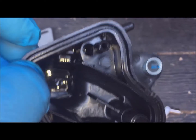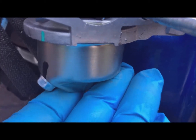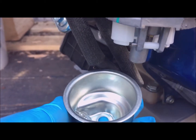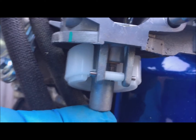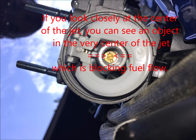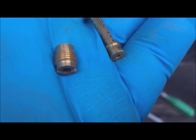It doesn't bode well for the life of this engine if it's already blowing that much oil. Accessing the jet means removing a screw that I'm pointing to right here. Once that bolt is removed, you lower the bowl — I already took it apart; the o-ring gasket is sitting over on the side, this is just for video demonstration — and then the main jet is screwed in here.